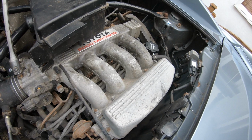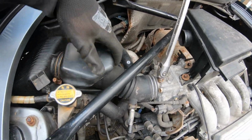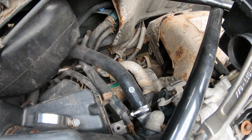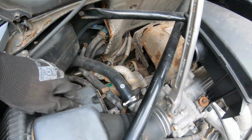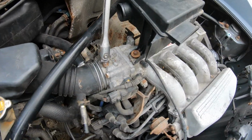So all the spark plugs have been put back in, and the HT leads are back on top. So I'm looking at the air filter now, and the box just pulls apart with these flick clips that are just here. There's 4 of them. Now this was sat on the top, which should have been bolted into that bolt hole in the middle of the screen. See another flick clip there, but it wasn't. So it's a bit loose, but it's all loose. I'm going to have to go through this engine and make sure everything's tight.